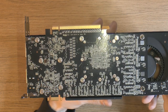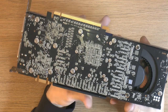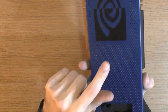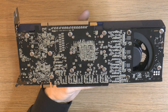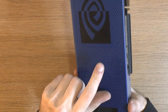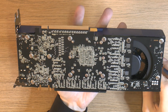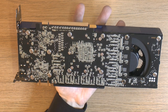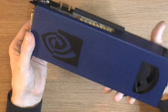And if you had the card mounted like this, like normally, the PCIe would pull on this too. So basically the card wants to fall away from the heatsink. So this GPU on this side ran about 90 degrees, and the other one ran at like 82. So adding these extra shims here dropped the temperature difference to about 2 degrees. So when this is 85, the other one is 83, and the other side started running a little bit hotter, but that's not that odd because we got better cooling efficiency on this side now, which means the heatsink is slightly warmer instead. But you want the GPUs to be very close, and it seems like the temperature is determined by this GPU on this side here.